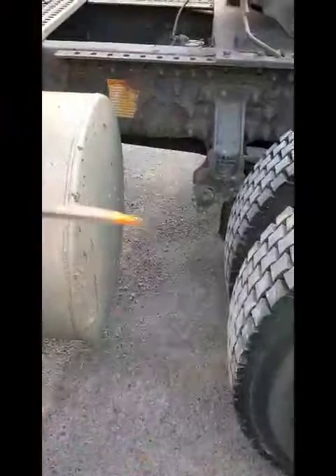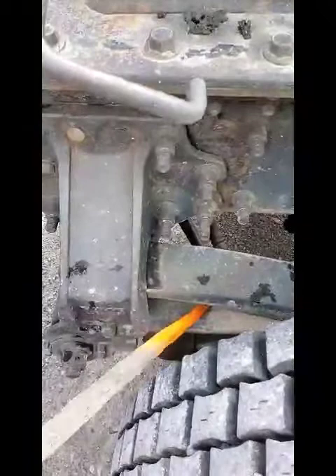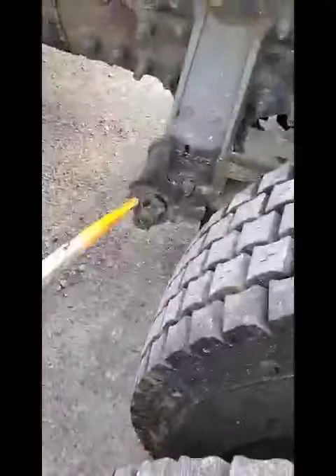Now we're going back to the suspension. My front leaf spring hanger is securely mounted, not bent, broken, or cracked, and its hardware is intact. My leaf springs are securely mounted, not bent, broken, or cracked. If a quarter or more of them were missing, we'd have to put the truck out of service. My bushing is not excessively worn.